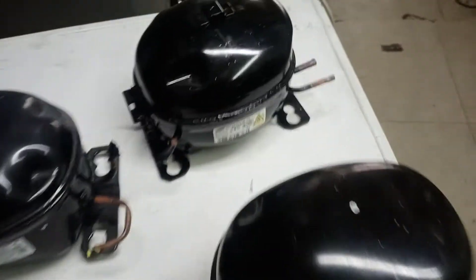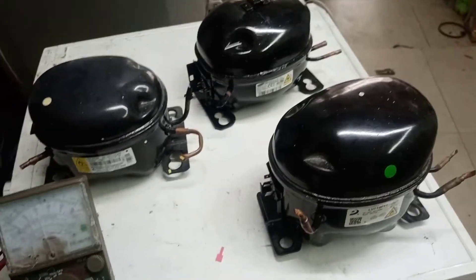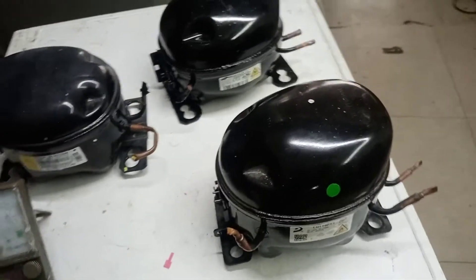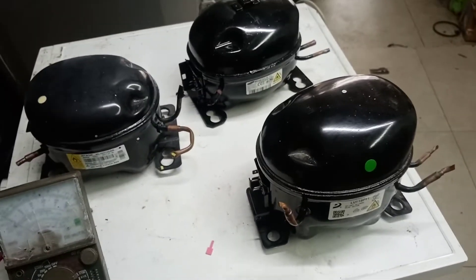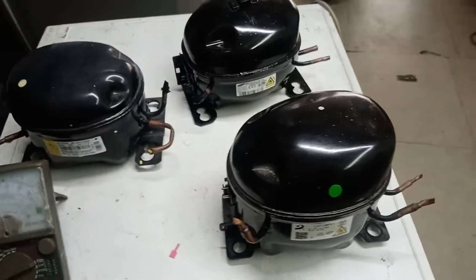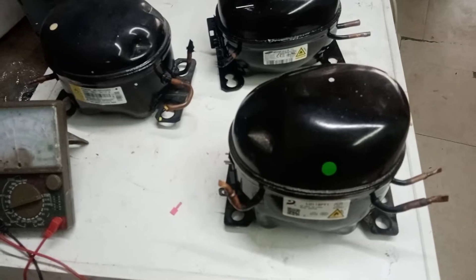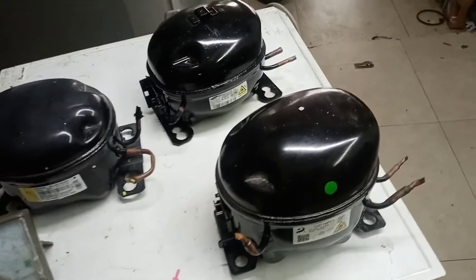You are gonna use a motherboard to check it. Let me start from the basics on how to check a compressor — whether it's inverter or normal. If it has R600 gas, it doesn't always mean that it's inverter. I have seen normal compressors with R600 gas, and inverter compressors with R134a gas. So it varies.